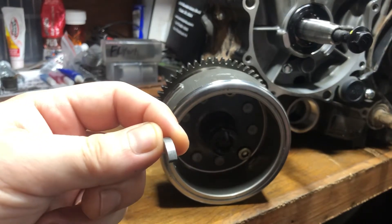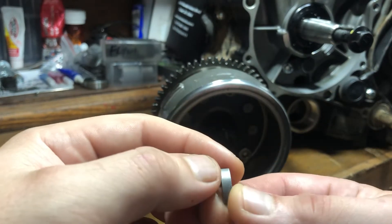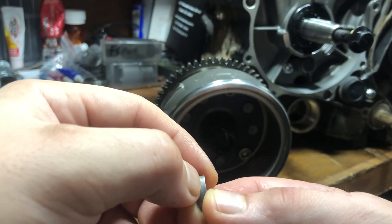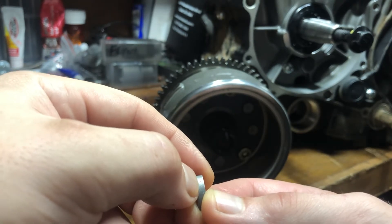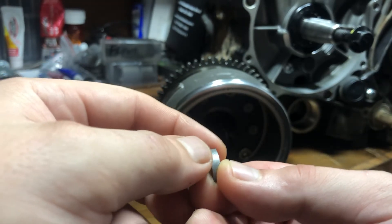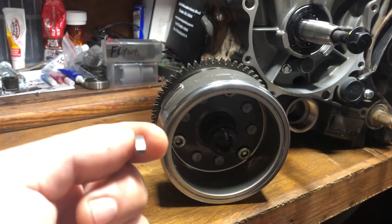Like I said, today we just have a standard flywheel key, so it doesn't have the notch. You can imagine if it did, it would just be thinner at the top. I've never seen them past about halfway, which is 12 degrees of timing change, whether it be advance or retard. In this case we're going to talk about a Honda CG motor that you would find on your typical China bike.